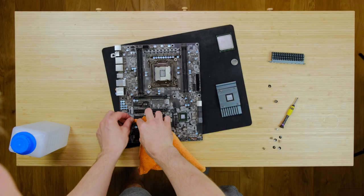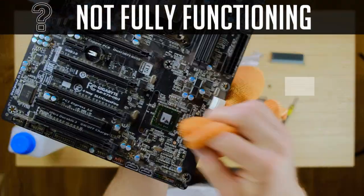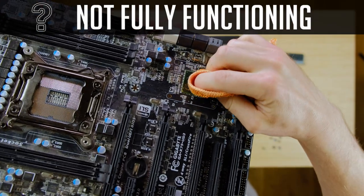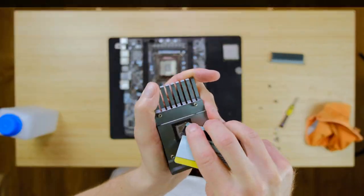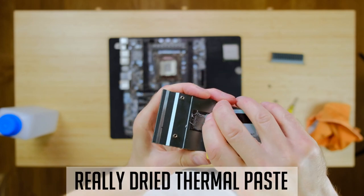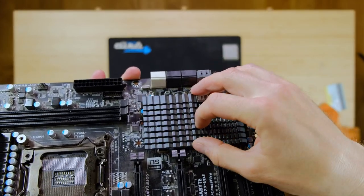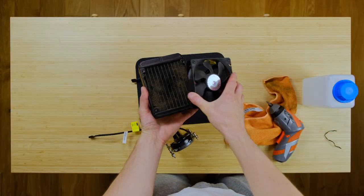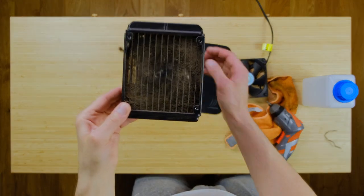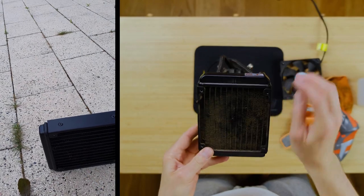A motherboard I'm using supports quad channel memory, but I've discovered one of the slots was not working anymore, so I was able to utilize a triple channel only. It's quite handy to have a compressed air can for blasting any dust from your PC every half a year or so. Anyway, it helped me a lot dealing with a dusty radiator. And finally, these parts look way better now.